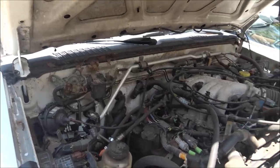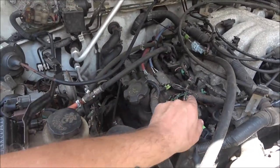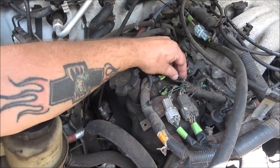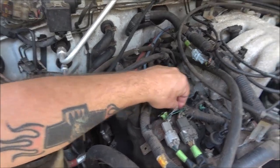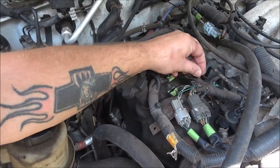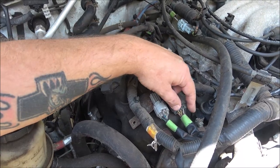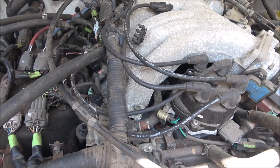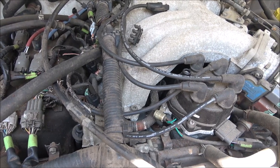There's a lot of cobwebs on this thing. I got to cut some of this back and find out — like that one there, it's a red and white wire, so I've got to find a red and white wire in there. The wire loom — this wire tape — we'll have to reconnect. It is also missing a spark plug wire; someone apparently used it for something else. I couldn't find it, so I did buy a brand new set of spark plug wires. You've got to buy a whole set — you can't buy just one.